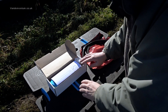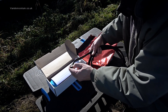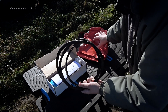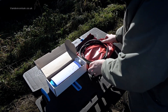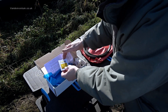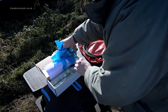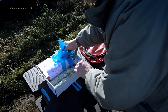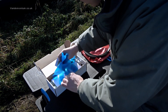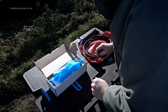I'll quickly show you the fitting kit these come with. Starting with this stuff, which is edge trim — once you've cut your hole in the van you bang this stuff on the edge once you've filed it down and painted it, and that forms the trim edge. They were supposed to send me six metres of this and they've sent me one metre, but supposedly the rest is coming today. And then here is the actual bonding stuff — you get a little wipe to clean your glass, some gloves, two tubes of super-stick adhesive, and also a little primer that you put around the windows with these little paint brush things. It's all quite technical but it's all designed to ensure the windows bond in correctly and won't come bouncing out of your van as you go hurtling down the M1.